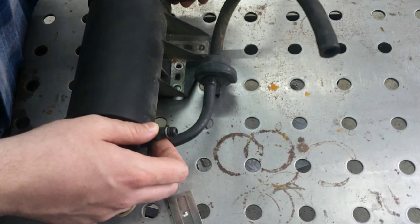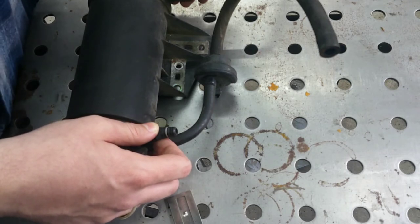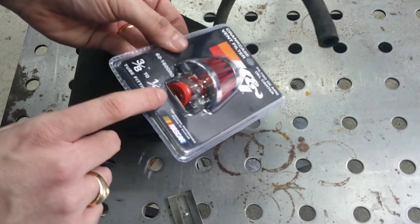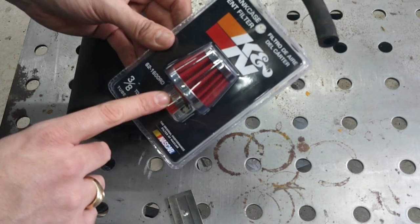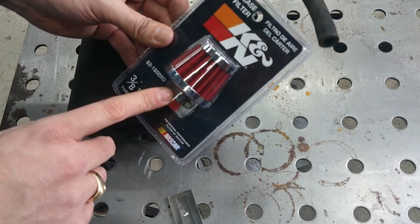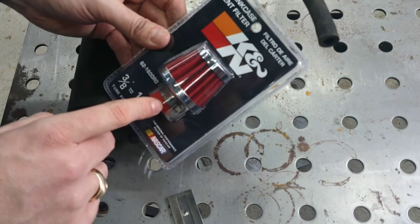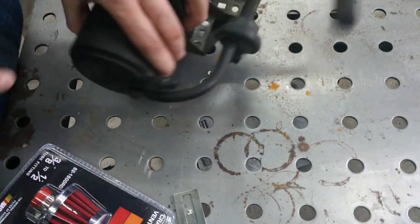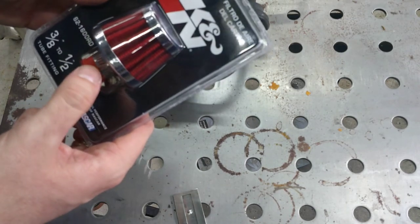So removing this does leave gasoline vapors within your engine bay. You're really only going to notice it during large temperature swings or something like that, so just be mindful — don't leave it next to anything that can spark. What I'm going to use is this little filter that goes from 3/8 to 1/2-inch with a slip fit. I'm going to cut the end of that blue hose off, slip this on, and tuck it back behind the brake booster somewhere so it's out of the way but still able to vent. I didn't see a lot of videos showing what to do with that bottom hose — they mainly just talked about the two top hoses. So I was scared when I first saw it, but don't be — it just goes to nothing, so you can unclip it.